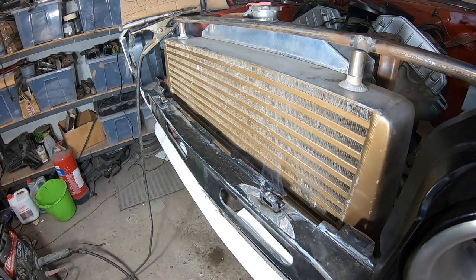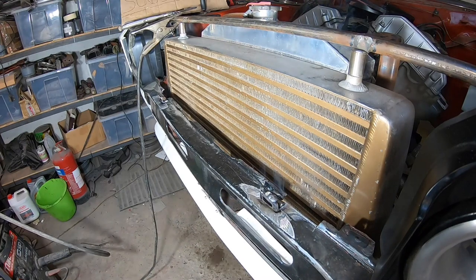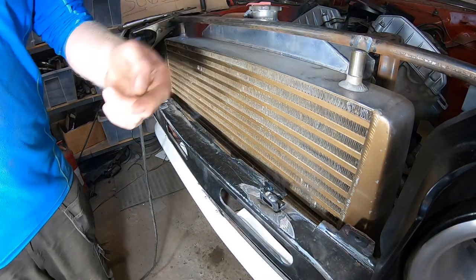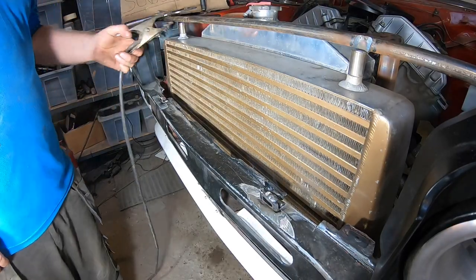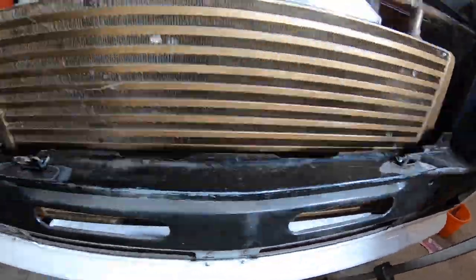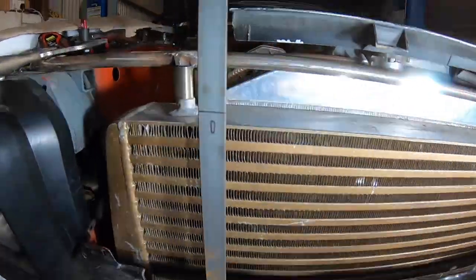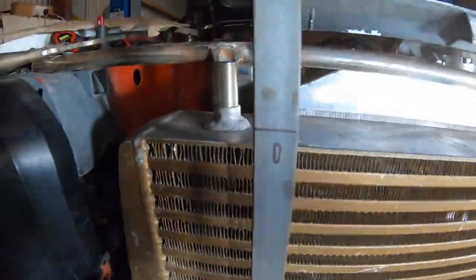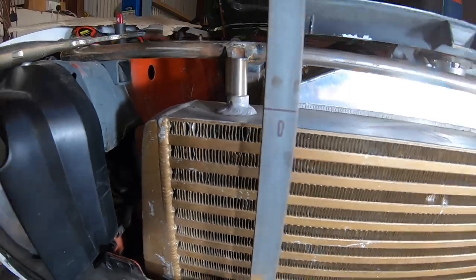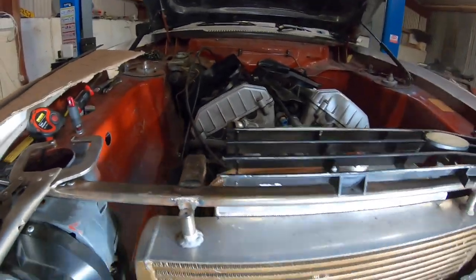Alright, the same load it on. Yeah, looking cool. Then I can fire the wee plastic doodads in and then work out how I'm going to mount the top of the grill. So that's the two tabs on. I think how to get the back of the grill on is to weld a bit of flat up, cut it off at the side, same height as the grill, and then put a rev nut into that so I can just bolt the top of the grill into place. It doesn't need to be holding a whole pile of weight, so should be ample.